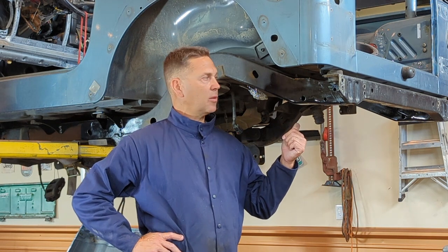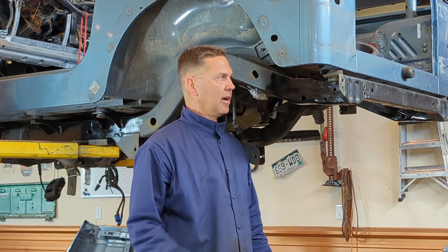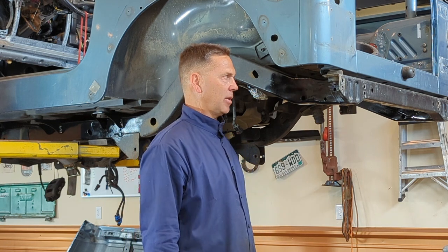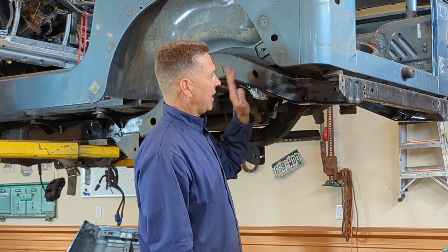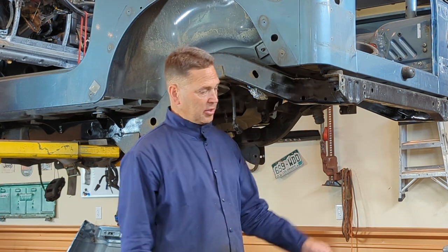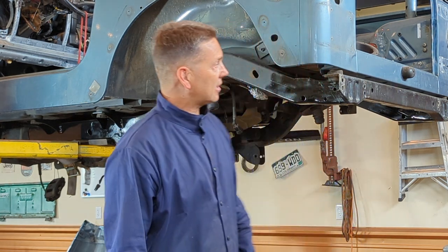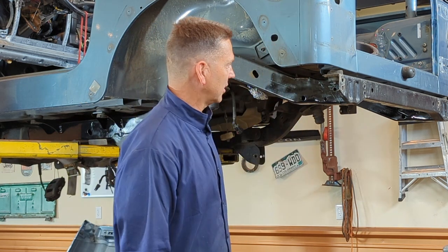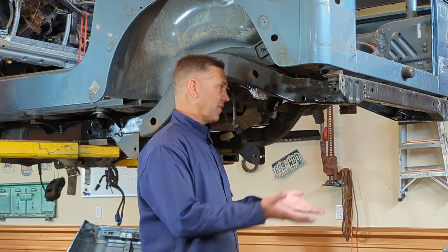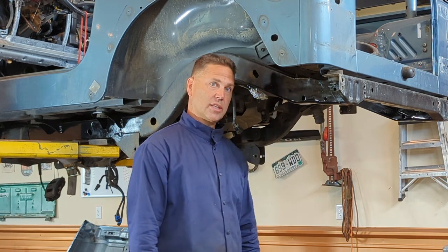Fish plates are completely welded in. Went through and primed and painted everything. Even if you plan on doing other work on your frame and think you'll paint it later, I cannot stress enough — just prime it right now because the metal rusts so fast it'll drive you nuts. After double-checking everything, you can see the gap in the back has been reduced back to stock. The frame was sitting down here and now it's sitting up here — another project in the books.